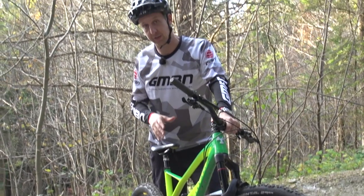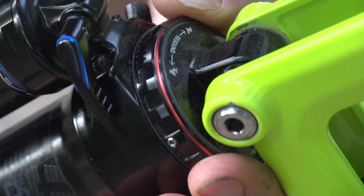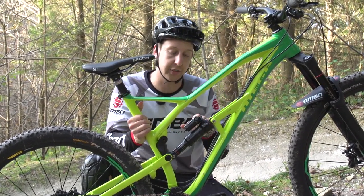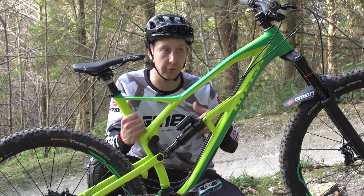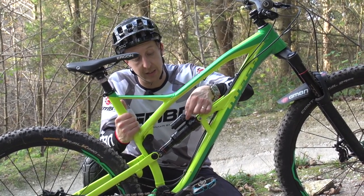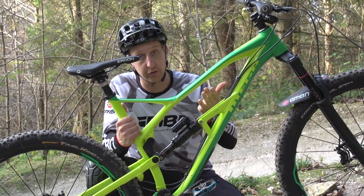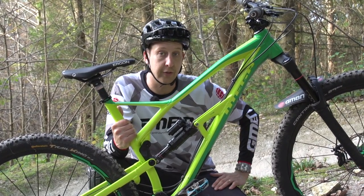The same thing applies to shocks, and there are different settings on them. On this rear shock I've got rebound adjustment — this clicky dial here — to control the extension of the shock. For compression, it's got a three-stage lever, indexed like your gears so you can easily find the indented positions: fully open, midway, and closed. Open is what you want when riding rooty, rough trails where you want maximum control and grip. The mid setting is really useful for climbing, where you want to keep the bike sitting up slightly so you're not going to strike your feet as often, but it still allows a lot of traction to the back wheel. Fully closed or locked out is the setting you want on the road or fire road — the perfect setting for an enduro event climb.